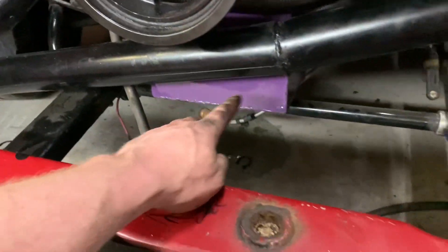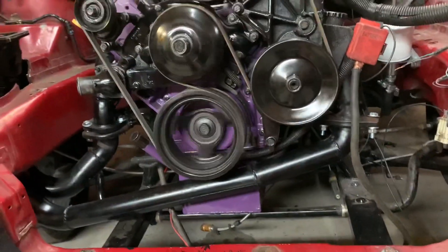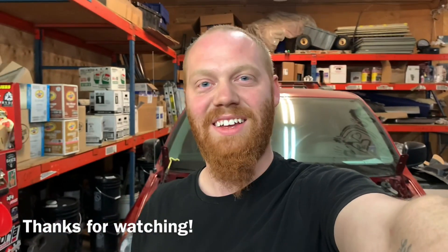I noticed a small oil leak - I checked around the perimeter of the pan and all the flanges were fine, but it was leaking from my drain plug. Wasn't on quite as tight as it could have been, so I put an extra quarter turn on it with the ratchet and it seemed to stop. Let's see if this thing makes any noise - all I'm going to do is touch this on positive. Listen to that! It turns over really, really clean - no clunks or knocks or anything. Turns over nice and fast, no dragging. That gets the blood pumping! Anyway, I'm going to finish up - it's almost 11 and I've got to work at 9 tomorrow. Thanks for watching everybody, have a good night!